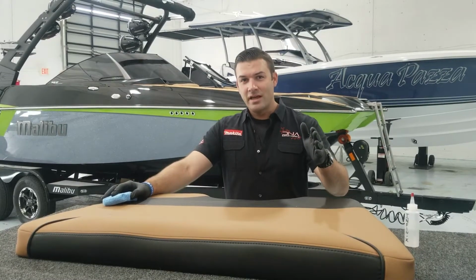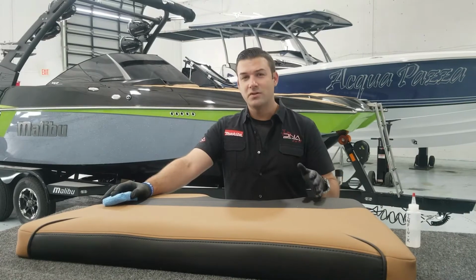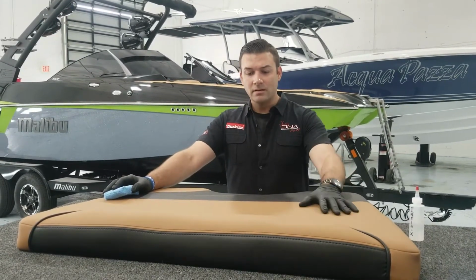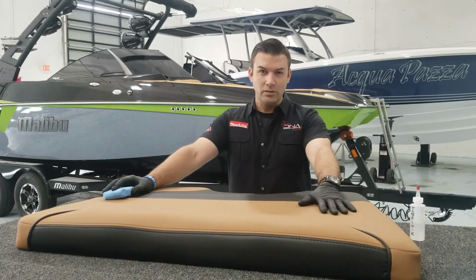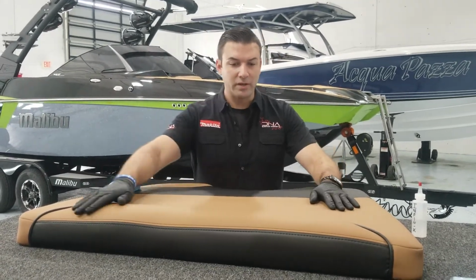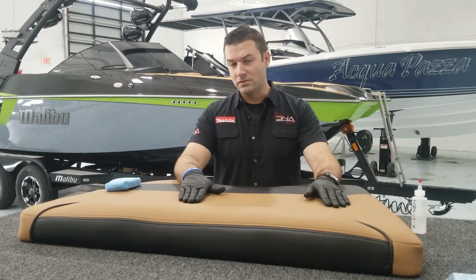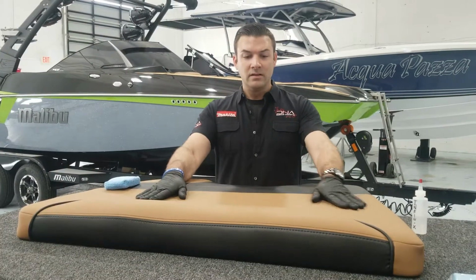The biggest concern I have for anyone doing these installs is really to take the time to make sure that all surfaces are truly, actually clean. So we had done a mild cleaner on this. You can use degreaser if you want, and dilute it actually. Magic erasers are great for pulling off all kinds of contaminants, and they really do a fine job of cleaning the surface. Once that was done, we used an alcohol wipe down and we were ready for business.